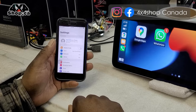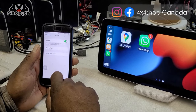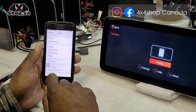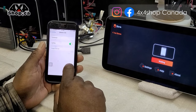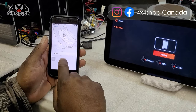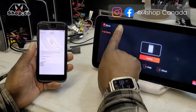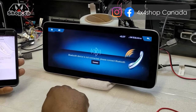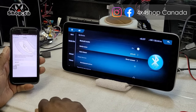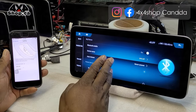Now the troubleshooting methods. If your Apple CarPlay is not connecting, go into your cell phone, select the Apple CarPlay device, and forget it from your cell phone. Then go into General and look for CarPlay. In here you will find the connected devices — forget them as well. If you have a vehicle plugged in, it will reinstate itself later. Select all your Apple CarPlay devices and forget those devices from your system. Then go home on the Android system, go to your phone section, and delete any connected device from there. These troubleshooting methods will help you make a proper connection if you are having connectivity issues. You need to clear it from all aspects, both the Android and your unit.